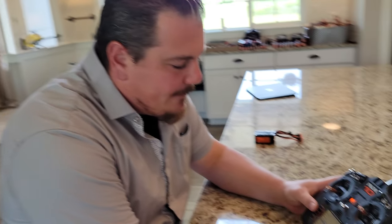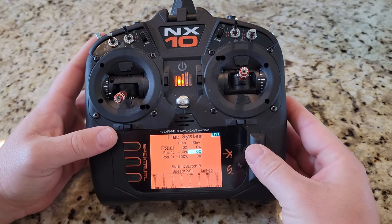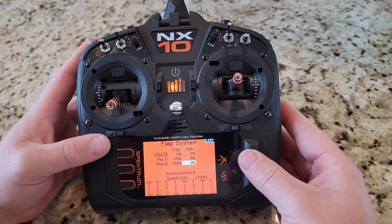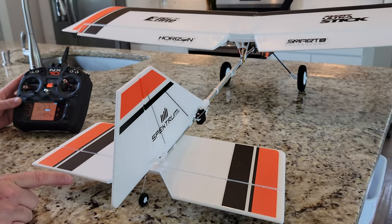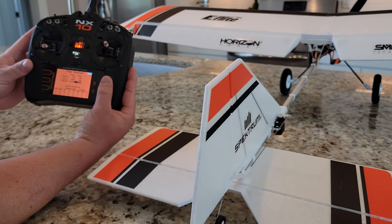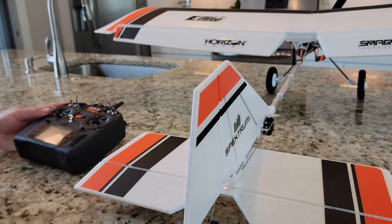So anyway, the other thing I just noticed is that for flaps, we never did set up a mix to the elevator, okay? I can't remember what it was because it didn't exist before, so let's just do 6 and 10. That seems to be generically a good mix. Now let's watch what happens. We are not in our weird spoilerons, so takeoff flaps, landing flaps. If you're not sure if that's going the right direction, you can increase this 10 to like 50, okay? You want that to go the same direction as the flapperons if they're full length.